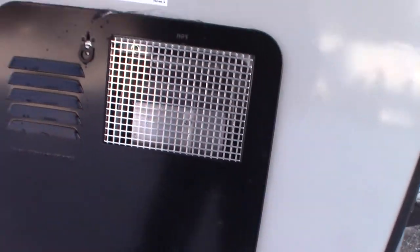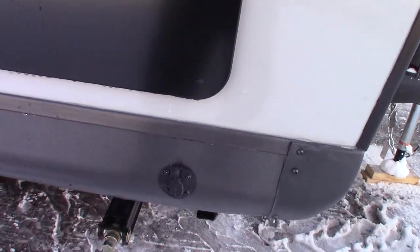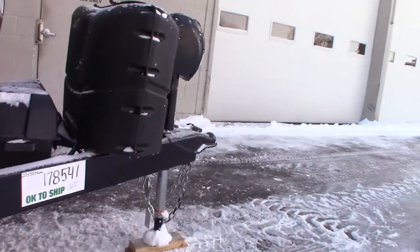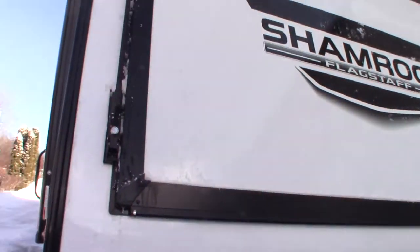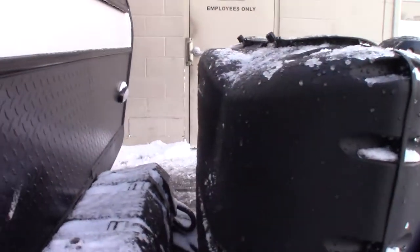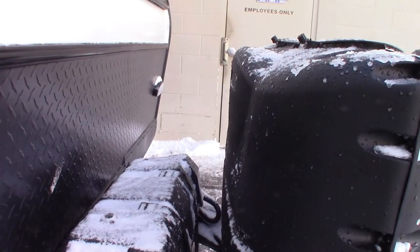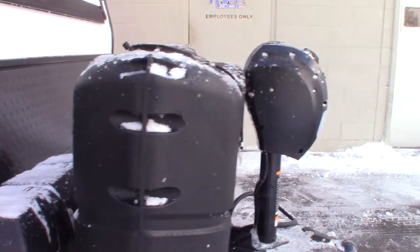This is just a hookup for a solar battery charger — if you want one, plug in here and it'll charge your batteries. You have your front bed door here. You have two deep-cycle marine batteries wired together at 12 volts, which just doubles your storage capacity.